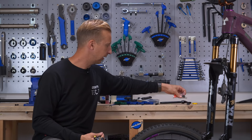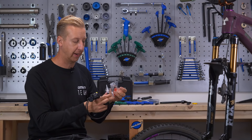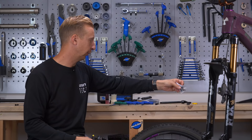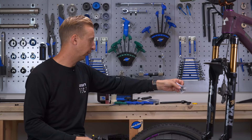Tools for the job: you'll obviously need the relevant brake. When you open it, you'll find a little clear packet on the inside — you'll need the contents of this. There's a disc brake pad spacer you'll need to install between the pads. There's also a little barb — a barbed hose insert — that goes inside the hose once you've trimmed it down. There's an olive and a little rubber sheath as well. You'll also find a little hose clamp that can help with trimming the hose.